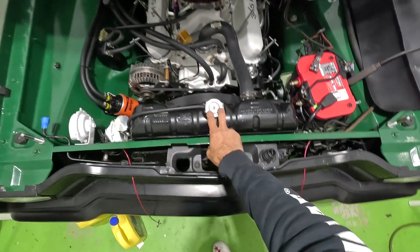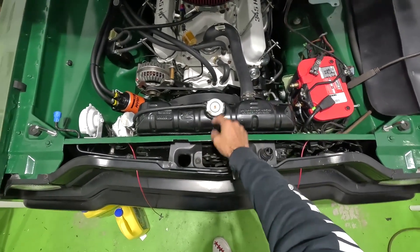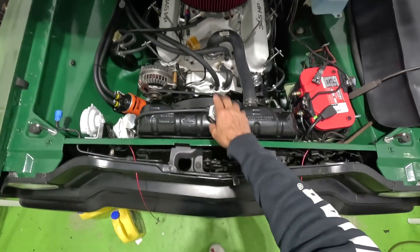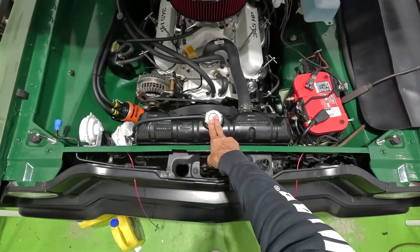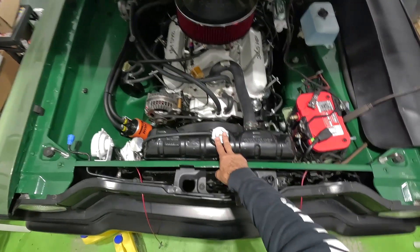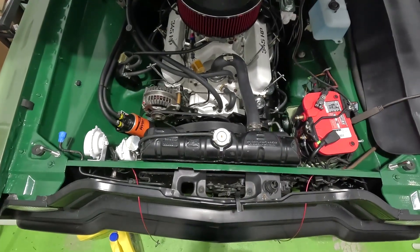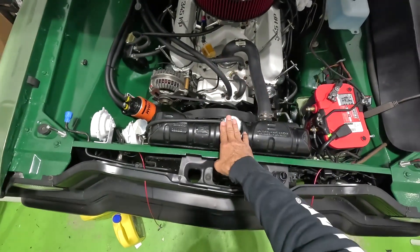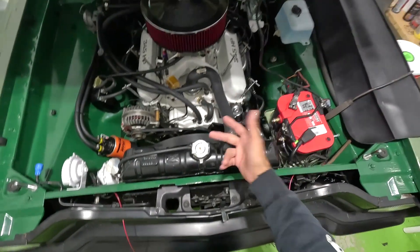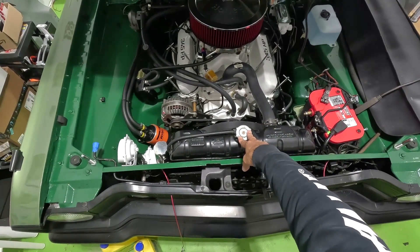This is the original radiator. I repaired it maybe eight years ago — I soldered it back together because it was leaking on both ends. It still gave me a problem with the 273, and I decided to use it here because I thought maybe there was something wrong with the engine. But as it turns out, I'm thinking it's the radiator — maybe too small. So I decided to do something about it.